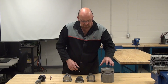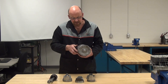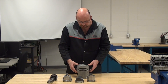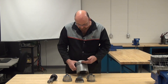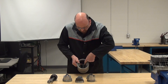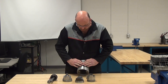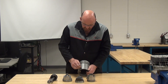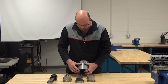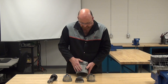The next one is another diesel piston — the squeeze cast fiber reinforced piston, called an SCFR. It's a full trunk style piston. It has oil return holes which allow lubrication from a piston cooling jet to help lubricate the whole skirt area. It's a corrugated type of skirt, which allows oil to sit in those grooves all the way around and helps support the piston during operation.